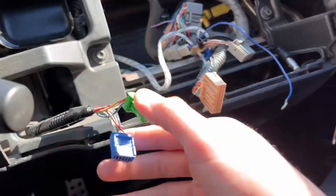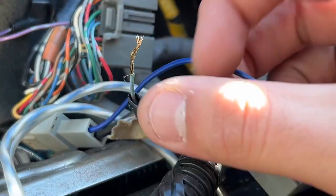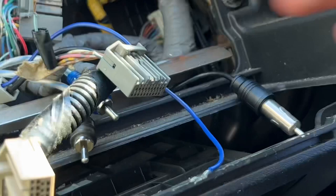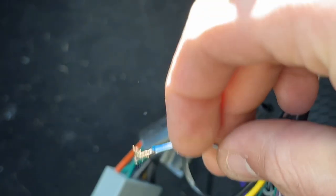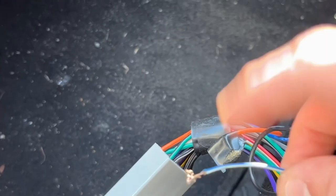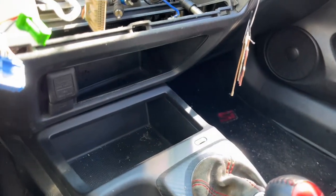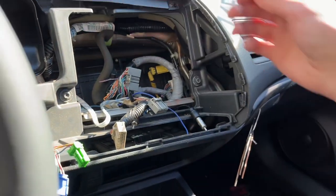Make sure you don't clip everything on the back and the whole trim will unhook. There's a little wire from the original harness that you're going to want to tap into and connect straight onto your radio's harness — the blue one with the white stripe. If you don't do that, you will get an issue and won't have any audio. Make sure you do that so you don't have to take everything apart and face problems later.